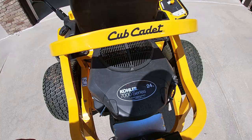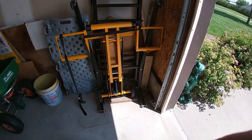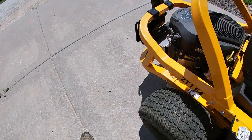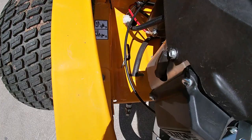Since I'm particular about cleaning, I bought the Cub Cadet mower jack that lifts and lowers it so you can get under and clean your deck. This mower also has freewheel levers on each side — you pull them back and put them in the loops so you can push it around without damaging your hydraulics. When you're ready to go, you let them go and you're good to go.